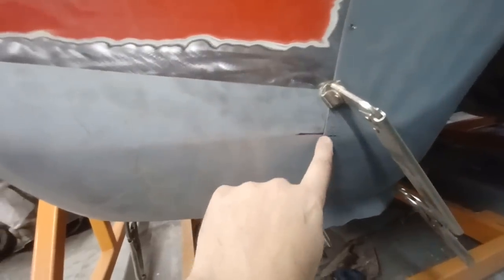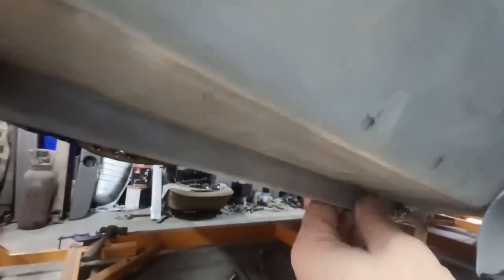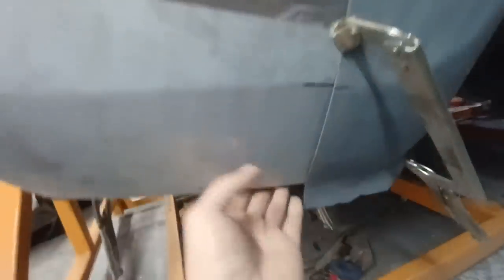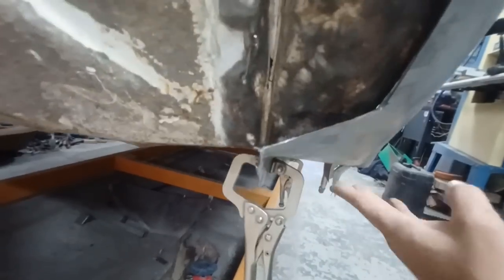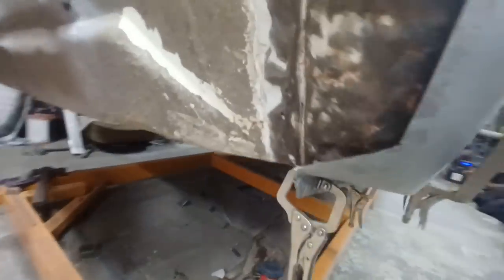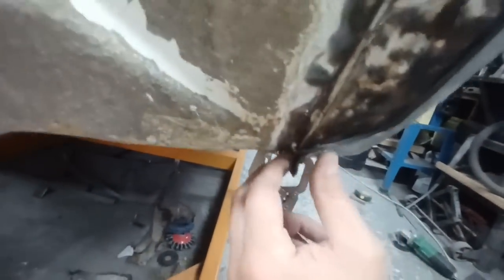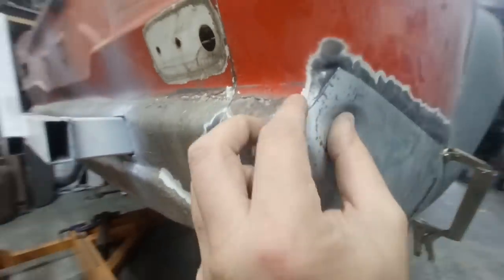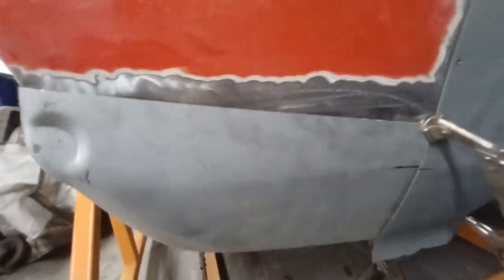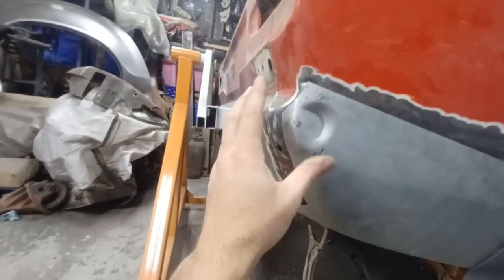You can get these swage lines to line up with some jiggery pokery forcing around. So what it basically means is clamping this one underneath, kind of where it's got to go, then forcing this panel down. So that needs to be almost running level, whereas before it was sort of tipped up a bit. Also means I'm going to have some fun around here, cutting and getting this into place, and up around here as well. But the bit that's going to be most visible is going to be here, because a lot of this will be kind of hidden behind the rear bumper if I have one.